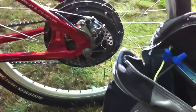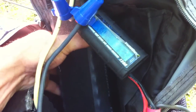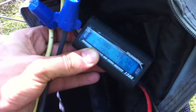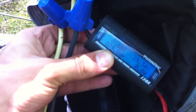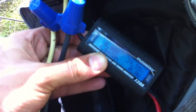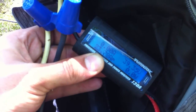I took the long way to the trails today because I'm testing out these Sony 18650 GR cells. It's fairly warm but not too bad. They're at 39.34 volts right now. About 4.847 amp hours have been taken out of the packs, and 23.7 amps is the max draw on this controller — good to know.